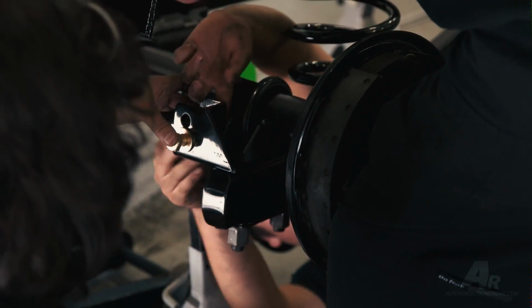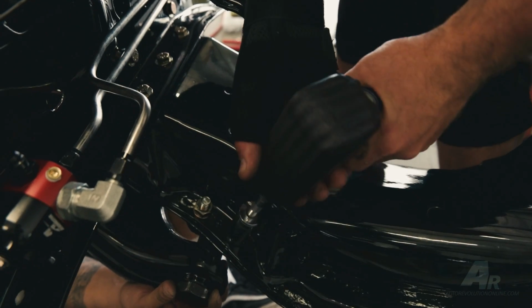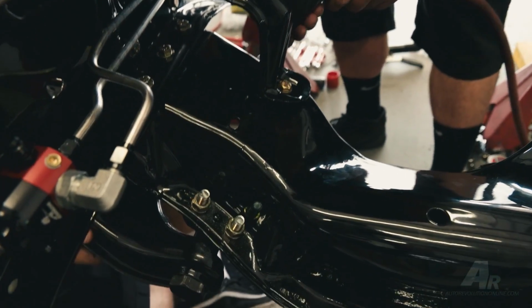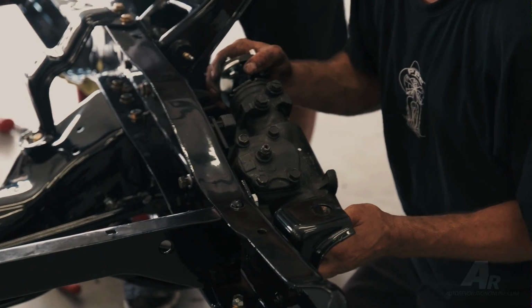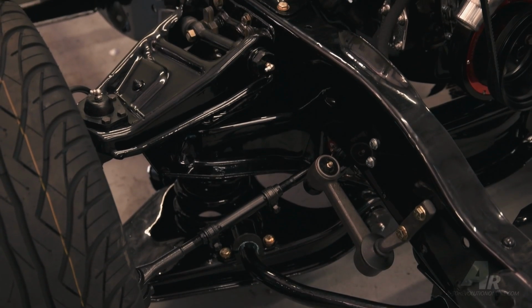Well, we've got our standard 4/6 drop, 2.5-inch drop spindles, 5-lug disc brake conversion, 800 series power steering gearbox. Rare Parts was nice enough to donate all of the suspension, the ball joints, tie rods, control arm shaft. Fearless Gear was watching the live feed and noticed that we needed the rear end, so they called telling me, hey, we're loading the truck and on our way.